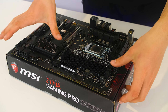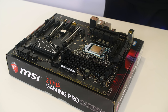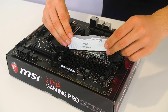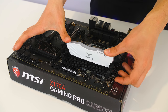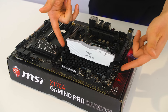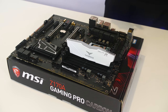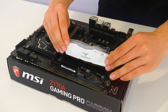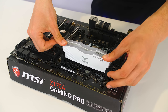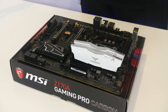To install the RAM, simply pull back the latches where you need to put your RAM sticks in. In this case we are using two; some of you might have four. Align the RAM with the socket, put one end in then the other, and push both ends down until you hear it click. The little tabs will push back in by themselves, ensuring the RAM stick is nice and snug. Do it again for the second one — make sure it's clicked in. And that's the RAM installed. Pretty simple.